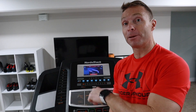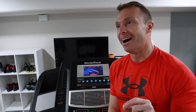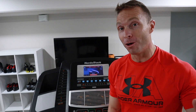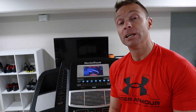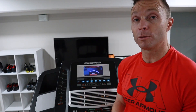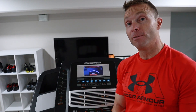This treadmill does not work perfectly by any means, but it works. As long as I launch the application and press manual workout within the first two to three seconds before the app crashes, I'm up and running — literally running. I can't say how happy I am that I took a gamble, went out and got a treadmill for free that wasn't working, and it cost us zero dollars to fix. I'll leave in the description all the links to download the iFit APK applications that NordicTrack tech support gave me, so if you're having the same problem — if someone deleted iFit or the app isn't working — you can delete that app and add it with the APK files linked below.